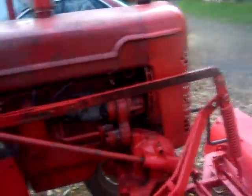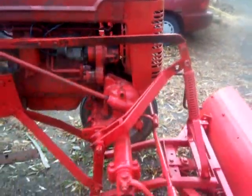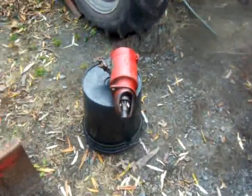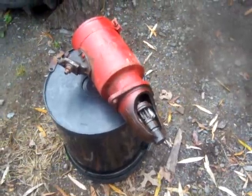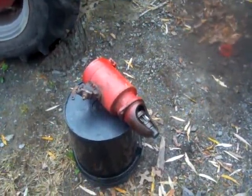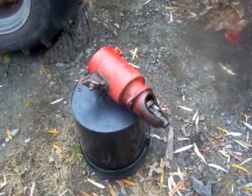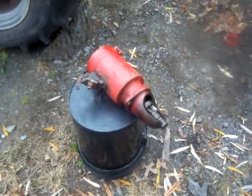Like I said, a couple of the other pieces aren't perfect yet, but it is working. It's looking good. No more hitting the body at all when it raises and lowers. I had it going great one day and didn't make a video, and since then I'm having trouble with the starter. It will not turn the motor over. However, if I pull the plugs out to relieve the compression, the starter will turn the motor over — no problem at all. Put the plugs back in, and nothing. It would just barely click. It will not turn that motor over.